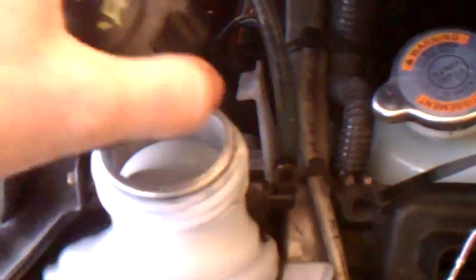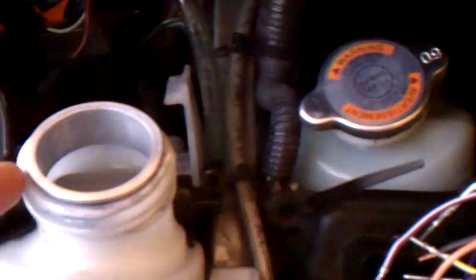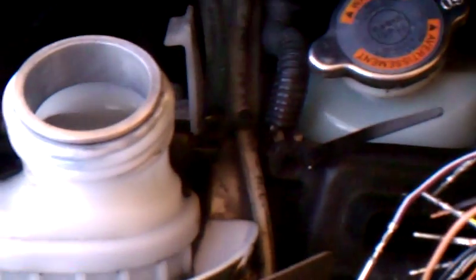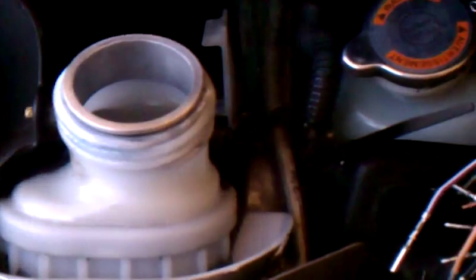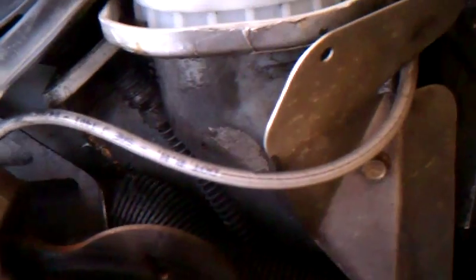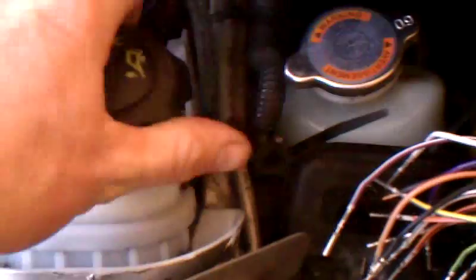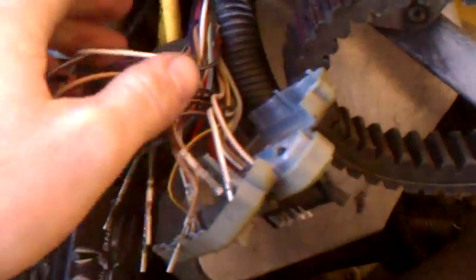Also put in that oil cap insert — our buddy on do talk sells it. It was a little tight getting in there, but my reservoir was definitely oblong and I was getting oil spilling down here, which could be a bad deal because you've got these brakes down here. Get oil on those brakes and you're going to get a fire or melt down your sled. Definitely recommend getting this insert, keeping oil inside your container, and keeping your engine clean.